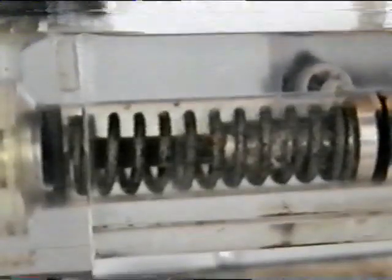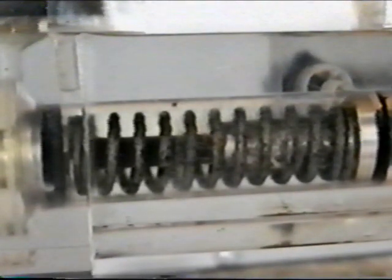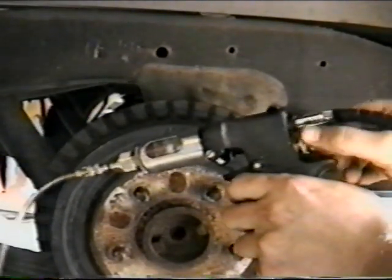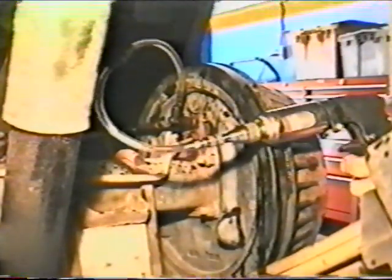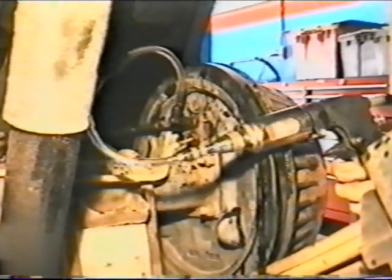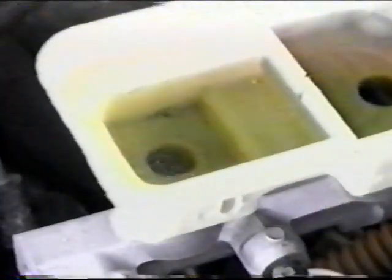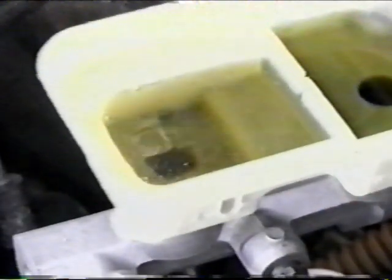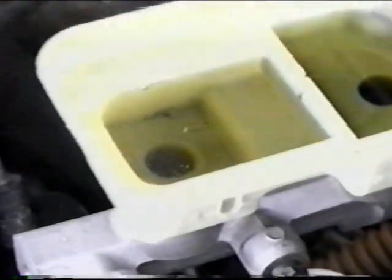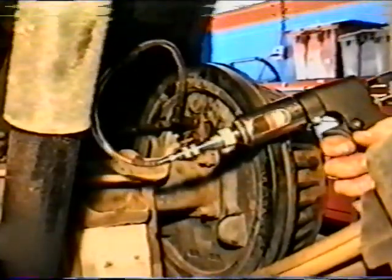Pulse generation can be done when either pressure or RFI bleeding. To perform the procedure, adjust the stroke setting on the tool to 2 to 3 milliliters. Using quick, short injections, inject 2 to 3 milliliters of fluid approximately 3 to 4 times per second. Inject a total of 10 to 15 short strokes, making sure not to overfill the reservoir or capture tank, depending on which method is being used. Finish the bleeding cycle with one full, steady injection stroke.